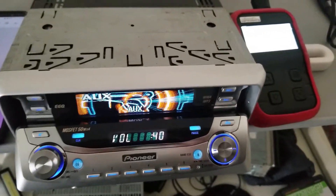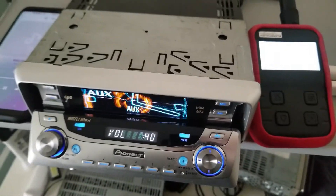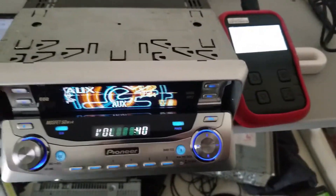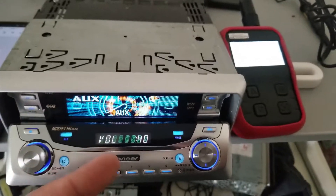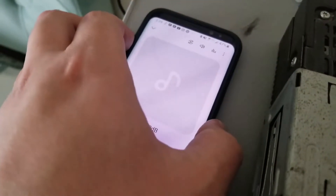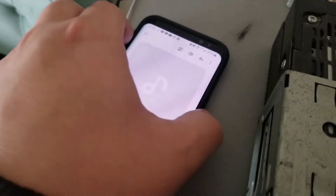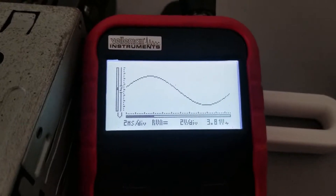When you're trying to have the maximum clean volume and maximum RCA output voltage, you want to start with whatever is most important. If you want your volume on the head unit all the way up and you know it's clean, turn it all the way up. Then go to your phone — I'm going to turn it all the way up also. I come to my oscilloscope and I see 3.81 volts, still clean.